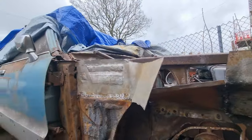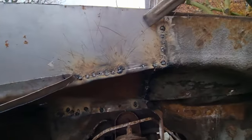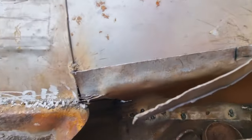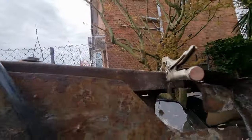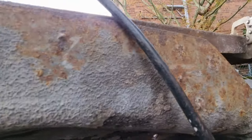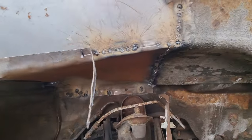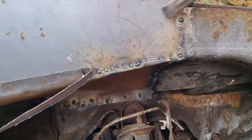Now I'm just working on this, and I'll get back to you when I've done some. Just tacking it while I'm getting it in. Here I'm going to do some spot welds. At the moment I'm just welding this, cutting the lip across, and then it will all line up right up to where the wing goes. I'll be back with you when I've started finishing that. And as I do it, I'm cutting along a nice straight edge — block to go with the wheel arch.